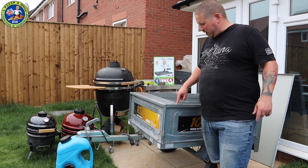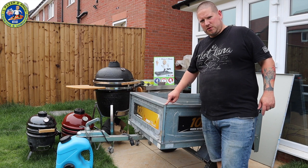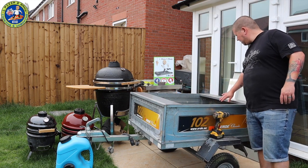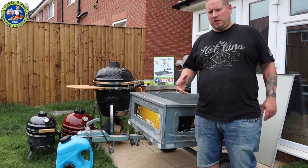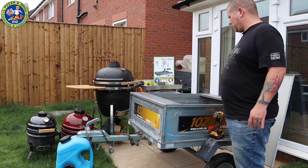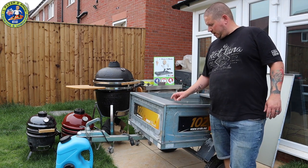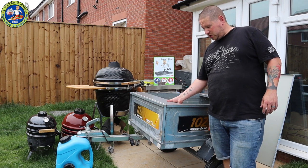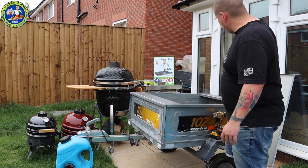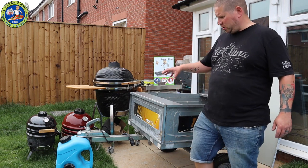I think the feet are going to be well onto here, so I'm just going to run these right to the end so it's nice and square — and again at the back. That will create a stronger corner and hopefully the trailer will be stronger. So what I'm going to do now is run a bead of sealant all the way around the trailer and put these plates back on.